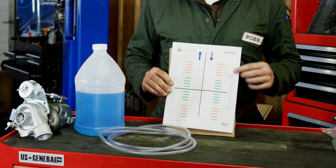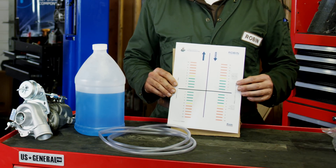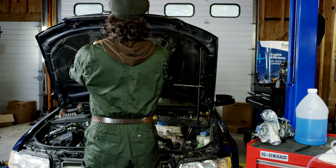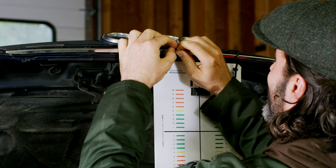The stencil is a simple line chart with a vertically marked scale on top and bottom for every centimeter up to ten. This scale will tell us about the pressure present in the crankcase. Marks above five centimeters distance on both sides are red and indicate excessive pressure or vacuum values. You can also use a ruler and markers to make your own scale, however downloading the stencil will be much easier.